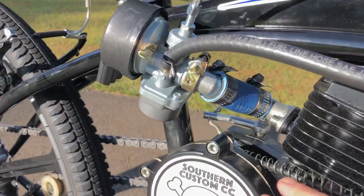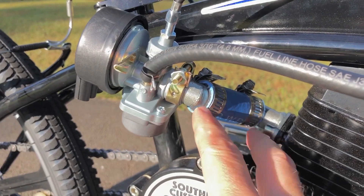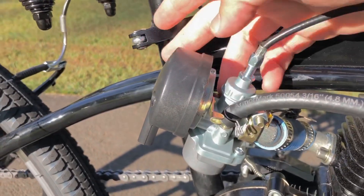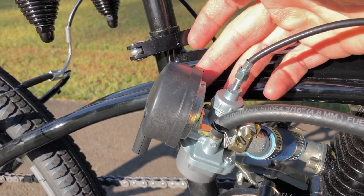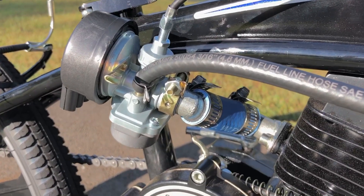The second thing I did is with the intake — I took a standard offset intake, cut it in half, and put on a silicone fuel hose. I elongated it a little bit because I wanted some more space between the carb and the frame. I didn't want it knocking the frame as I was riding, so I just had it pushed out just a little bit.